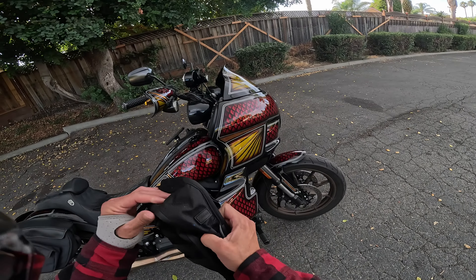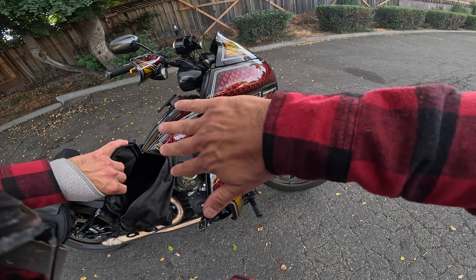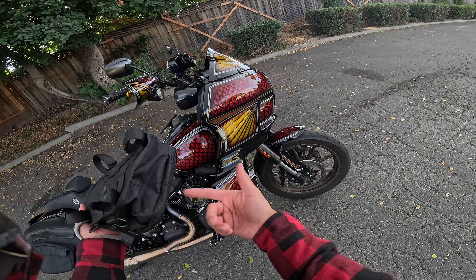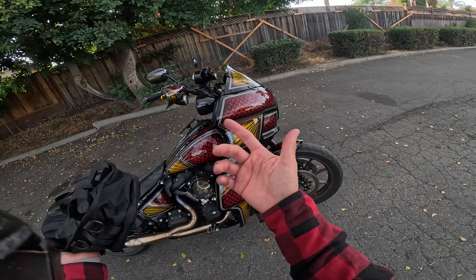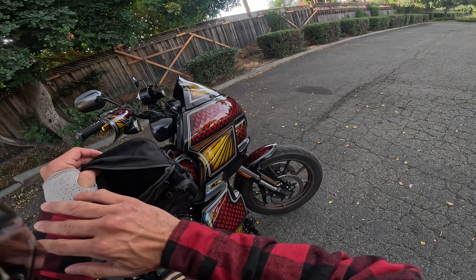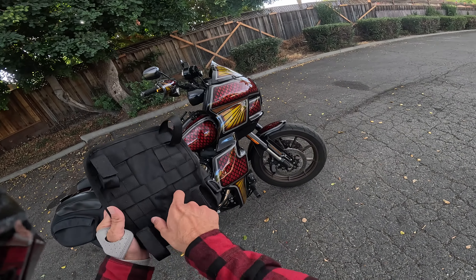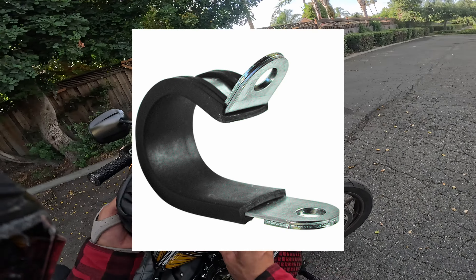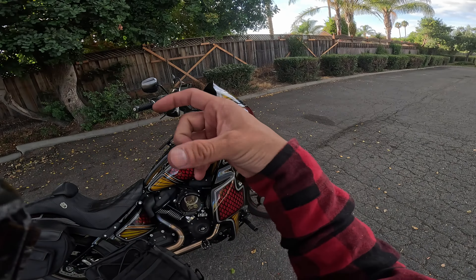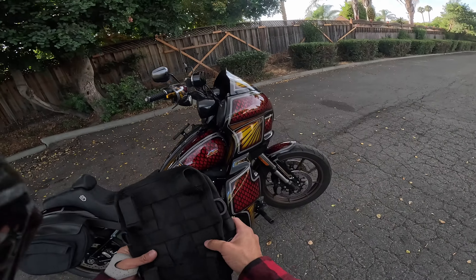As far as making the bracket, you could actually just get an ABS plate, put it in there, mount it to your amp, put that inside, and then you could also drill holes so you could pull the power cable out and all the speaker wires. You could hide it pretty good in this little handlebar bag. I'll try to find an image — you'll just drill it on here and put conduit clamps onto your risers, and that pretty much solves that issue.